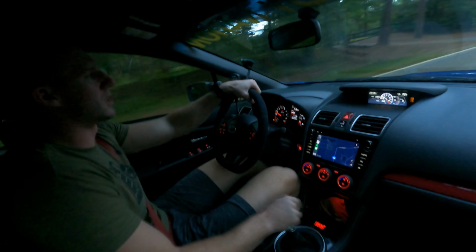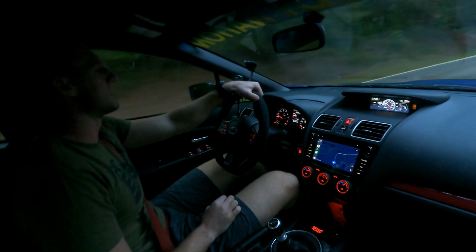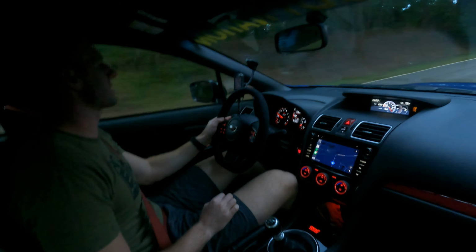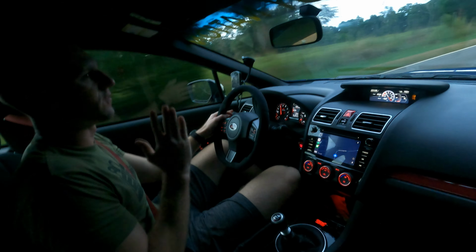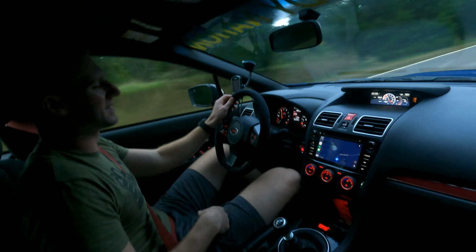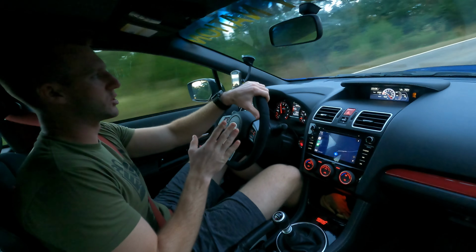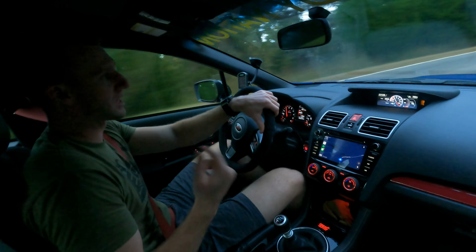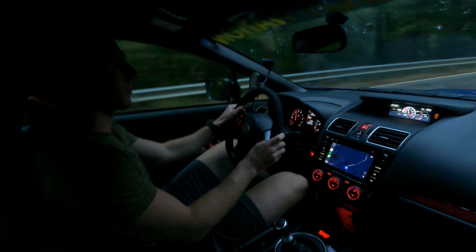See some issues coming up. So that was not a lot of throttle input and we already hit 60% injector duty cycle. Also, you guys might have noticed that there was a little bit of clutch slippage there. The stock clutch is not having a good time. It still works, it just has to be fully engaged, and honestly it's still not too happy about it. Even if you're not hard shifting, you're waiting till the clutch is fully engaged and then you're giving it the beans. See, I'll creep up 20, this is 2500 right here.